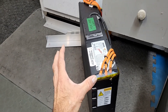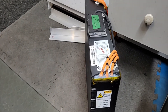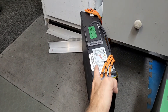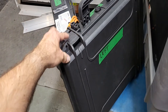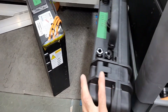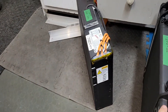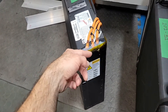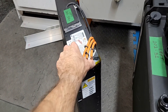I cannot put one full block of two batteries on the motorcycle — it would be very difficult. So I'm using these really nice cases, like the Storm or Pelican style case from Italy. These fit the batteries nicely, except that I had to cut the power lead on both sides, crunch them a little bit, and install wires.